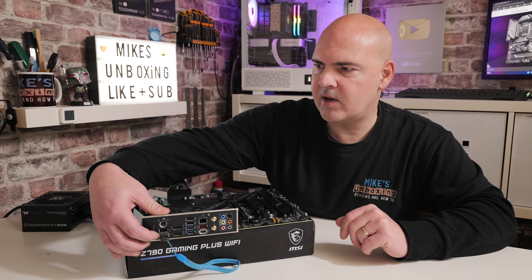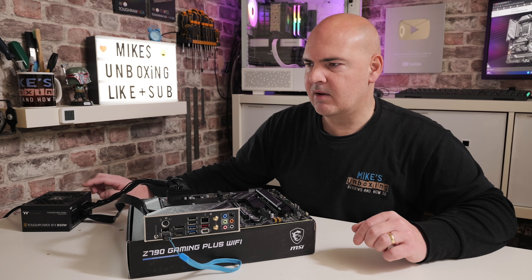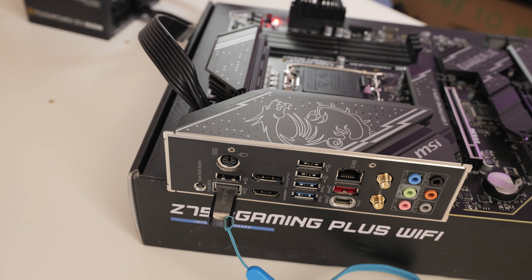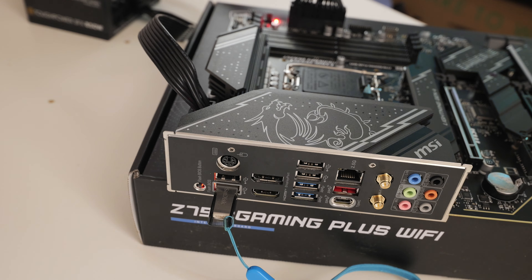So pressing and holding — one, two, three — and release. You can just about see there is a little bit of flashing going on there. The power supply has clicked on. So now what we want to do is just leave the system. You'll also see from the back there's a red LED for CPU because we haven't got a CPU connected — that is absolutely fine. The LED is flashing, so just leave this alone now. It should take somewhere between five to six minutes to complete. If it goes on longer than that, the chances are it hasn't worked, at which point you can turn off the power supply and repeat the process. If it stops flashing after maybe five or six flashes and goes solid red, it's basically not reading the USB drive. I'm happy — this is going through what it needs to do. I'll give you a close-up of the back LED so you can see what it looks like when it's flashing.